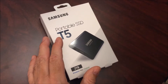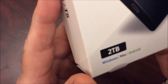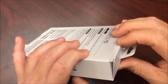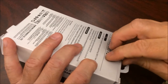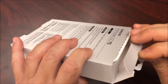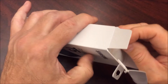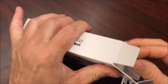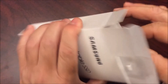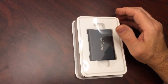Hello, welcome to another hacky tip video. Today we're going to show you how to upgrade a hard drive on a Lenovo Yoga 2 Pro ultrabook. Right now this laptop only has a 256 gigabyte hard drive — with this upgrade I'm getting eight times more capacity. This video is also useful for people that want to upgrade their Yoga 2 Pro to any size. The problem is that mSATA drives are only available up to one terabyte on the market, so the workaround is to buy a Samsung T5 portable SSD, open the enclosure, and remove the two terabyte mSATA inside. If you only want to upgrade to one terabyte or less, you can just get a regular mSATA SSD. Everything you'll need for this project will be in the Amazon links below in the description.